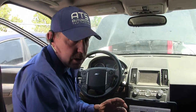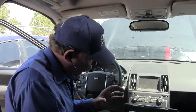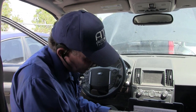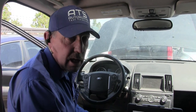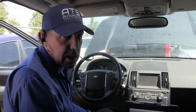What I want to do to double check is take the TTL out on my scope and put it into this bus line just to make sure they're not grounded. This makes me think they're not grounded, but I always double check things. I'm going to take the TTL out, feed it into this line, and make sure that we see a toggling — that tells me we don't have a totally grounded bus. So let's set up the TTL.